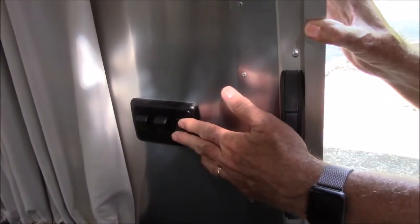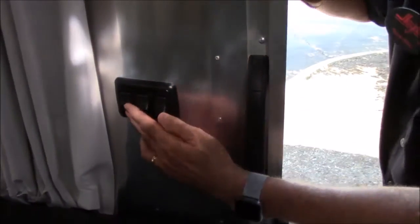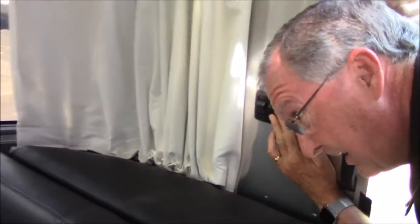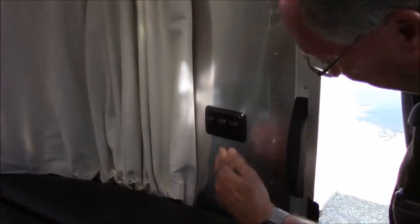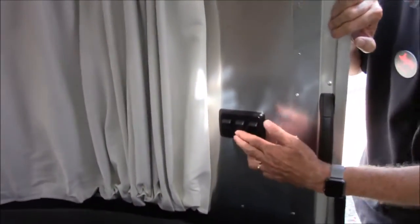Let's go inside. We're going to plug in here so we've got some power. Remember I talked about this being polarized - you can see the little L right there. I'm going to plug it in and turn it about a quarter turn clockwise. This is the adapter you need so that you can plug this in at home. It goes on the end of your 25-foot 30-amp cord - I'm going to put this on here and then I can plug this into a standard outlet like at home or your extension cord. Then when we go inside, we'll have some juice.